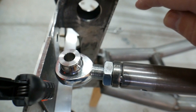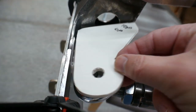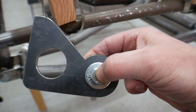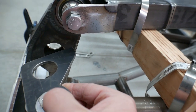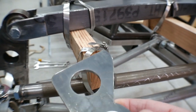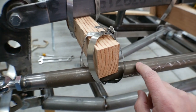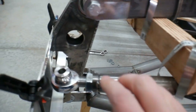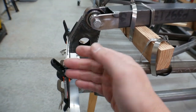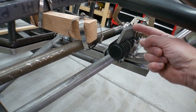I have made up some foam board templates that I think will work here, and then I've transferred these over to steel. This is the shape that I think is going to work. Now what I need to do is just lightly tack these in place so that I can actually remove these two by fours — they started as two by fours but I ripped them down to the proper height. I'll be able to remove those with this tacked and bolted in place, and then I'll actually cycle the suspension and check my bump steer. If I need to make some minor adjustments, I can still slide that point in or out to make corrections.